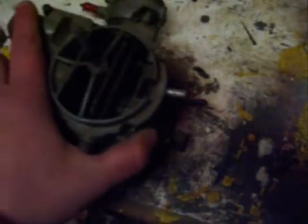This carburetor is a little different, but once again, you have your brake. This ran to my breather cover on mine. I had another little heat tube in it, so it would open up. And my vacuum advance off of that. PCV was off the front. And then your fuel line.